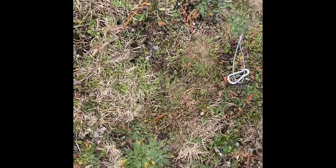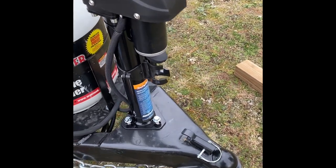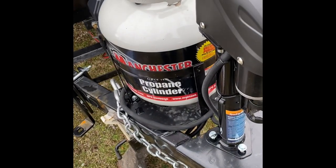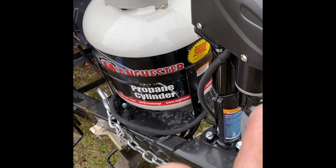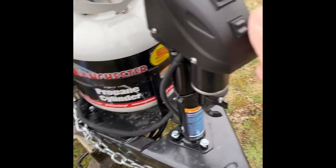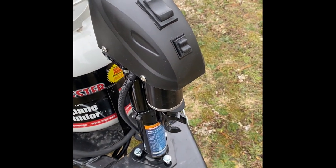To make my life easier, I did use a socket wrench with a long extension so that I was above the jack stand when I put it in. As you can see, the new one fits right in place, and now I'm going to tighten these three bolts down tight. I've decided to orientate it so that the switch is facing the front, but if you have clearance problems with your tailgate, you could always rotate it about 66 degrees either way — that way this area here would clear your tailgate of your truck if that were a problem.